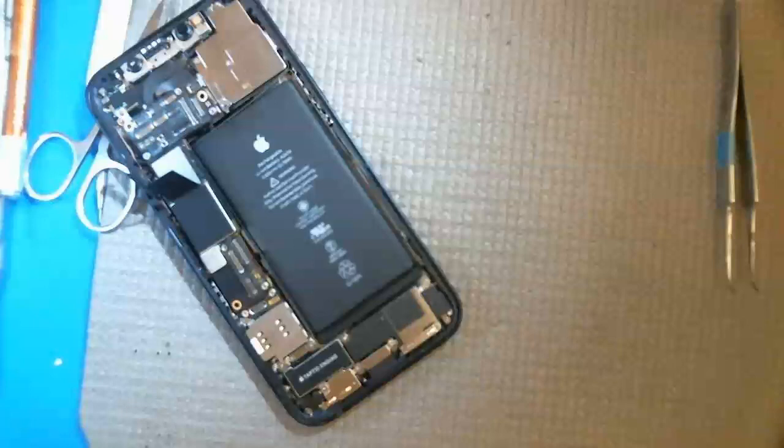There's something right here that's definitely soldered on — pretty certain it's soldered on to the logic board. I guess it's possible it could just be adhesive holding it, but that wouldn't really make sense because there's also a piece of tape on top of it. So that does not make sense at all. In order to take the logic board out, this flex right here runs all the way up. There's one I can separate that goes to maybe the power button, and then there's a flex that splits up here and goes all along here — so you have to take all this out.